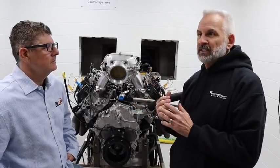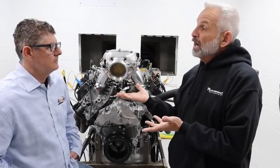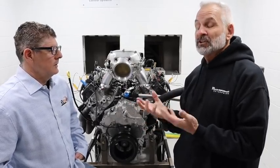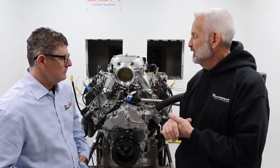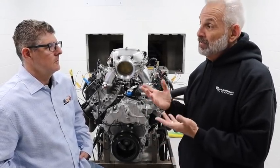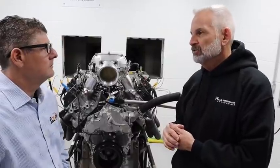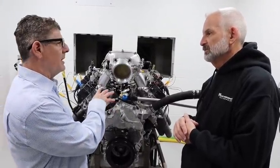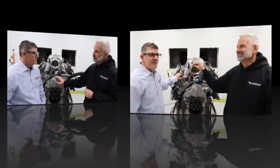The engineers at Ford are brilliant and can get the same power any tuner can get — but why don't they? It's really about component protection, and the biggest piece is the catalyst. Those catalysts have to work for the certification period — I think it's 120,000 miles — so they have to ensure all emission components perform at the end of that cycle just as at the beginning. That requires some compromise to peak power to keep the catalytic converters cool. This engine is equipped with four knock sensors, so it's pretty robust. As for going from 93 octane to race fuel with this bottom end, we didn't get into any detonation during testing.